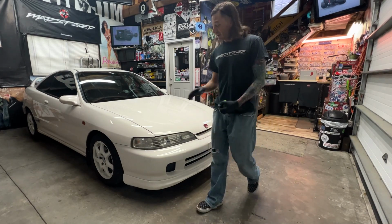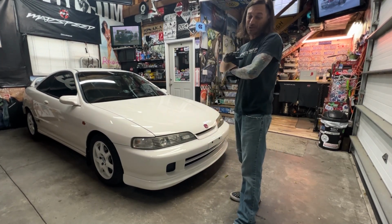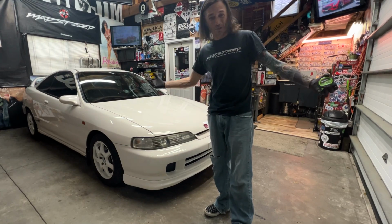There are a couple adjustments there. This is about 1/8 of an inch lower than this side, but I want to take it around the block again and just settle everything and see how that does. When we bring it back, we'll take another measurement and see where it is. Kind of a tedious thing, but this is the way this one goes.